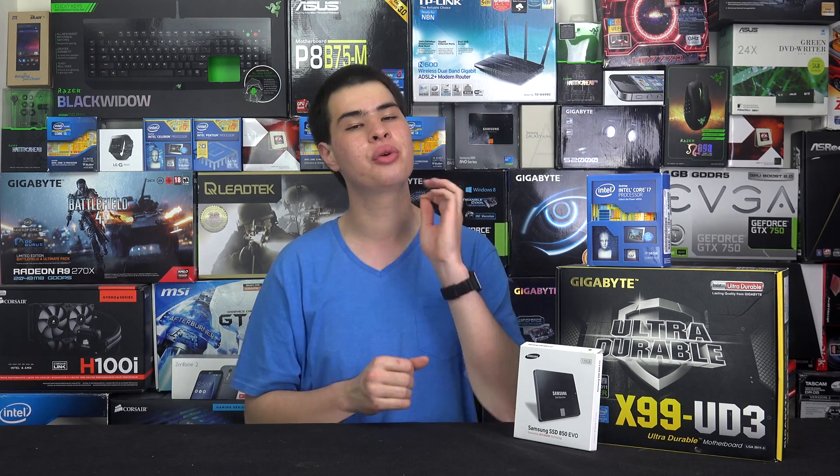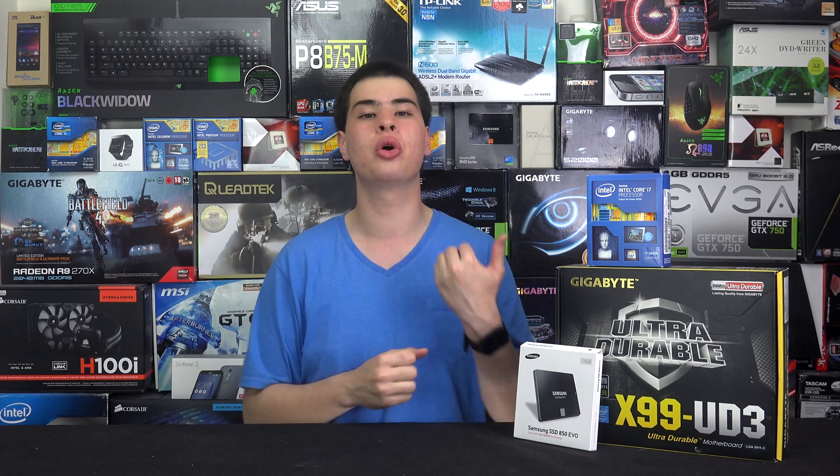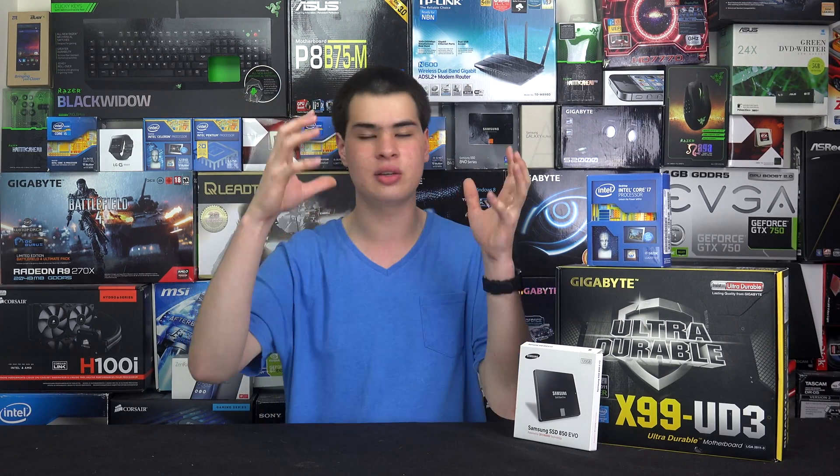We'll be handling audio through HDMI. Finally, the way we're setting this up needs to be run through an HDMI cable to your location. Whilst you could set up a wireless connection, it's better to have an actual physical cable running from the graphics card in the server device all the way to your monitor. This won't be much of a problem if all your computers are centralised in one room, but if they're dotted all over the house, you may want to look into wireless accessories or running some long cables.